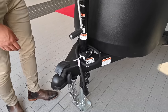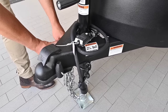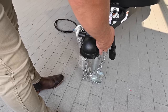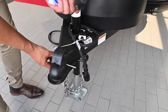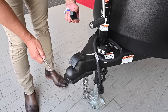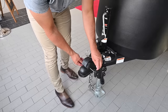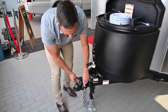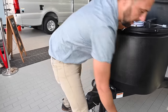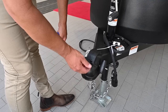The frame is coated with a highly protective textured paint. This is a two and five-sixteenth inch ball with 11,000 pound safety chains. Colonial Airstream gives you a Demco coupler compatible hitch lock that slides through and prevents the coupler from lifting up so no one can get their two and five-sixteenth inch ball underneath. There are also aftermarket hitch locks — my favorite is the Alturo lock — that cover the whole area for enhanced protection.